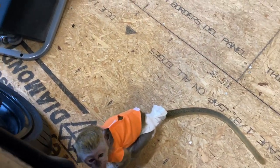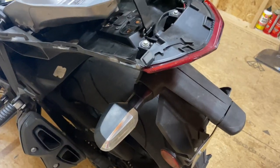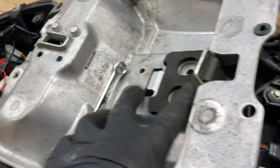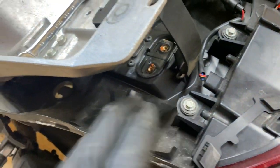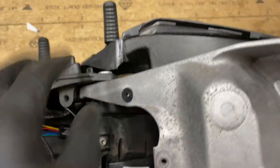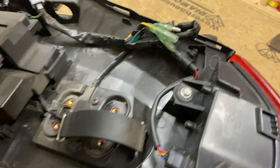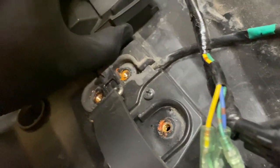Mojo is helping out down there. To remove the tag bracket, take out these four bolts and it comes down. When removing the tail, I found there are actually two additional bolts underneath beyond the four up top. To detach the undertail from the subframe, just take off these two bolts and the whole undertail comes out. Then unhook all your wires — the clips push down to pull out. The computer system right here should come off from this point.